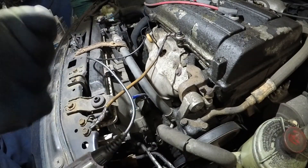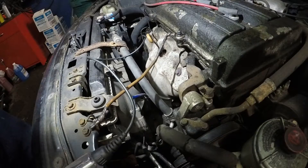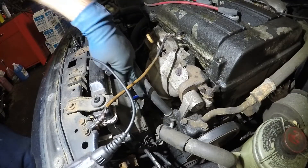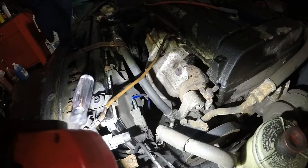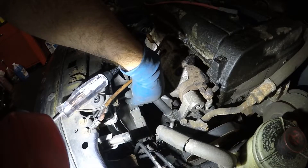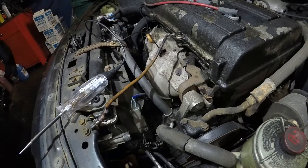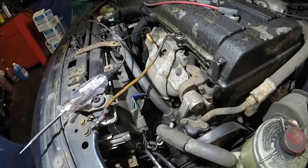This car was overheating and it's not cooling the radiator down, so we're going to replace that fan. All I did inside was put the key on so the engine is still off, and I jumped the cable at the sensor to give it a signal and confirm this connector has power and ground. That's a clear indication the motor is bad.